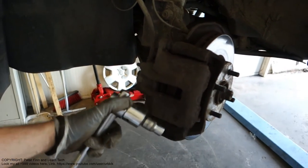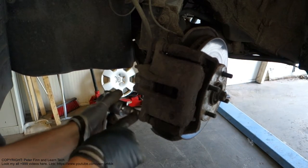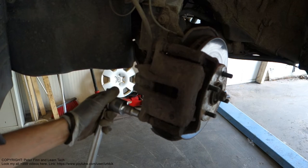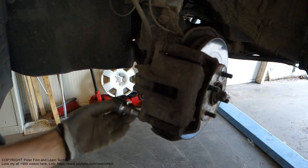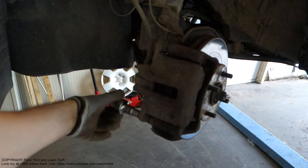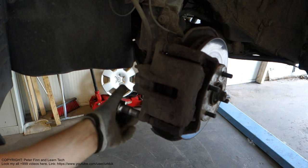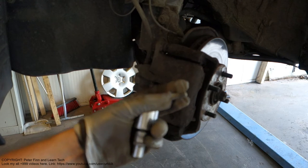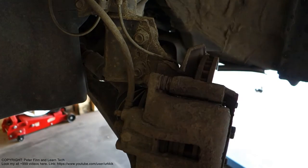Then I open the lower bolt in the same way. Be sure you also clean these bolts if they are full of sand, because then it is much easier to open. Now, when these bolts are loose, I can rotate them out using only my hand, because these Toyota bolts open so easily, since the bolt material is so high quality. Then I have this upper one, and please put these bolts in a clean place.